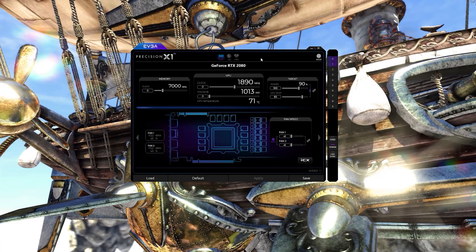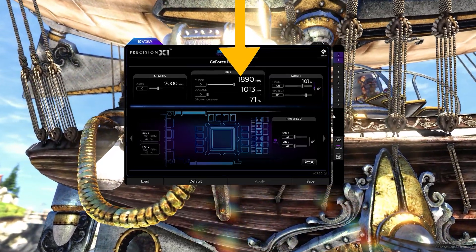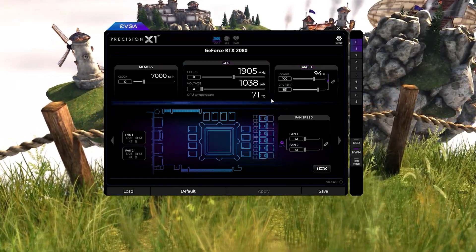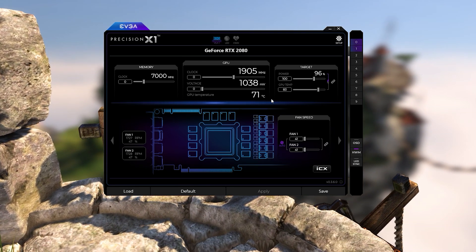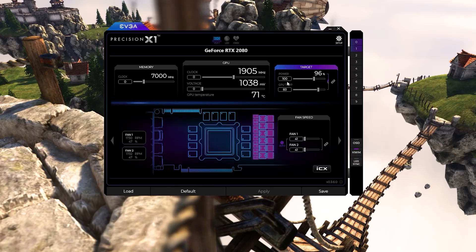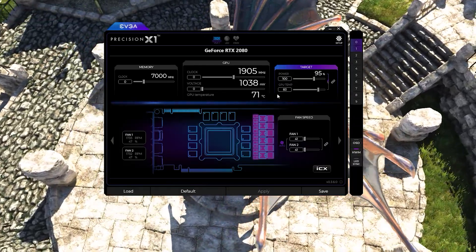So those three parameters govern each other — there's always a three-way power play. If you want a higher clock speed, you need lower temperatures, but you also need higher voltage, which means higher power draw. So you have to have all three combined together. When you're using Boost, your video card will go up and down in frequency based on those three parameters. Most people do not know Boost is operating in the background because it's built into every card — it's baked in and you can't turn it off, which is good and bad. Good because the average person doesn't need to know about it; it's keeping the video card at a safe operating temperature while giving you maximum performance. If you're doing manual overclocking and want to squeeze everything out of your card, then that's when it becomes a problem.